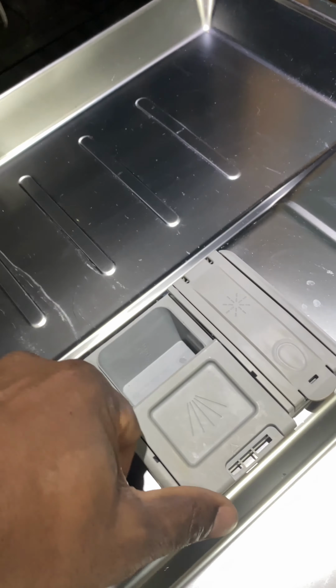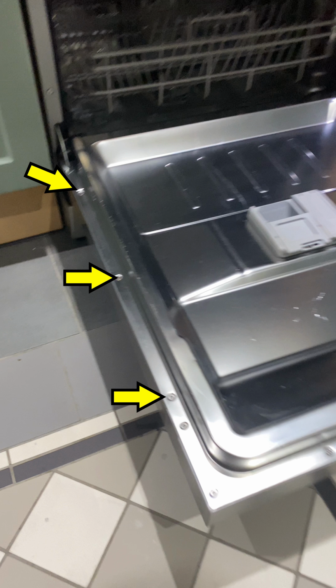First thing I'm gonna do is disconnect the power from the wall socket. Then there's just three screws to remove the front cover, three on this side, and there's some screws up here also which you don't need to undo. They hold the handle, and they're Torx screws, so it's just three on each side. Just gonna undo these three also.